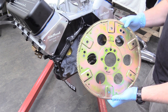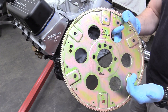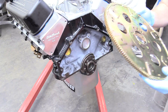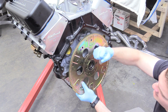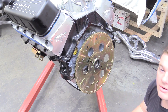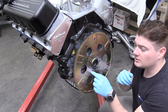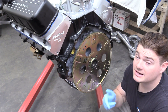Here's our Summit Racing flex plate — link down below in the description. My transmission guy Mark pointed out that this is the rear, so this faces the transmission. But if you didn't have that marked, how could you tell? There's a little chamfer edge here that needs to face towards your transmission — you can't have that facing towards the engine; the engine side will be a completely flush surface. There's an alignment dowel on the back of the crank — you just line that up; it's a little bit of a press fit, so don't be afraid to use your fist and hammer it on a little bit. Some crankshafts don't have a dowel and instead have a slightly different bolt pattern, so you'd have to line up all the bolt holes perfectly. We have a dowel here, so we know we are correct, and that applies to both flex plates and flywheels.